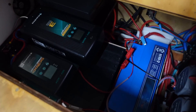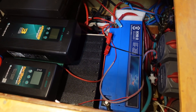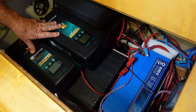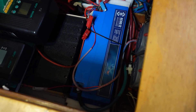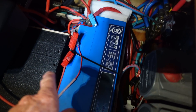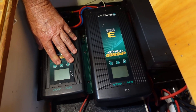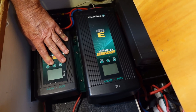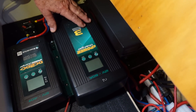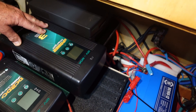This is my system. I'll turn some lights on. The other battery is under here. I've got two 326 amp hour lithiums, and that's my start battery — I use one start battery for both motors. That's my DC to DC charger for charging from the engines. So that runs off the start battery into the house batteries, and that's my Enerdrive battery charger. I used to have two of these chargers but one of them let the smoke out, so rather than buy a second one I just put in a power supply as a backup.